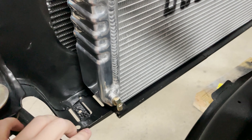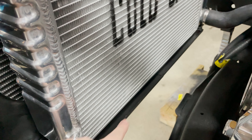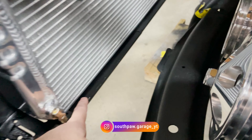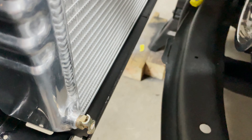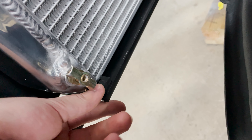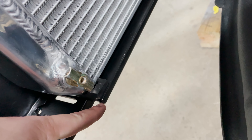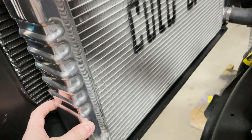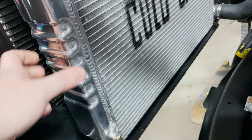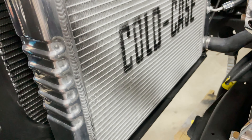If you look down here under the radiator, you'll see this little support that goes all the way across. It's two pieces of fairly thick aluminum and it has a lip on the end — it's kind of hard to see the lip because we painted these black, but it comes out and then there's this little lip right here. That lip comes up around the rubber piece here, so the rubber piece is sitting in the low part and the lip comes up around the front of it, and the same goes for the far side. We did this because this radiator, being wider than stock, comes out past the bottom of the radiator support, so we wanted something under here to keep it from leaning, wiggling, and wobbling.